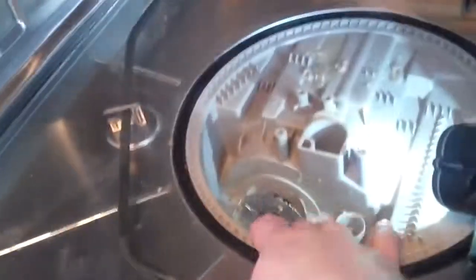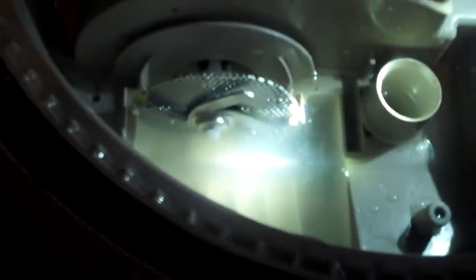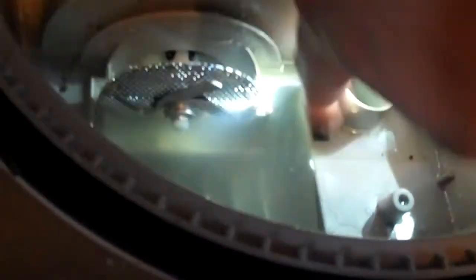After cleaning this out you find uncooked pasta shells, seeds, pieces of plastic, rocks, dog hair, bones, and a pumpkin seed. The longest part of this project was just getting in there with my hand and routing that stuff out. There's one more step: a rubber flapper valve. Reach down and get that out — it's located right down there, that black part. Just reach in with your fingernails, grab it, and pull it out. It opens and closes to let your dishwasher drain. Mine was clean, which was amazing.